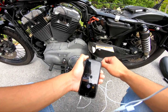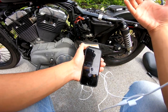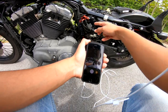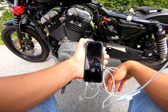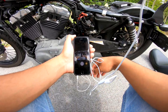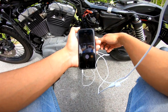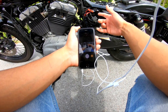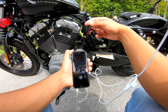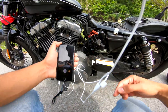The first thing I would do is take off the seat. If you can, hopefully you carry some type of multi-tool with you. Take off the seat, inspect all your wiring, make sure all the connections are good — especially for the fuel pump and your starter. My bike was cranking just fine, it had a very strong crank, so I knew it wasn't the battery. And I knew it wasn't low fuel because I checked the gas tank and made sure I had fuel in it.